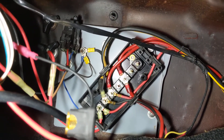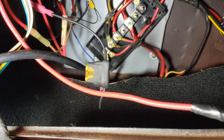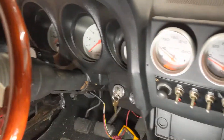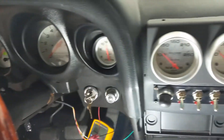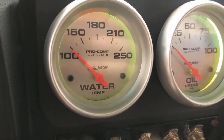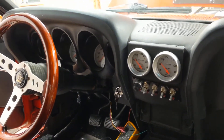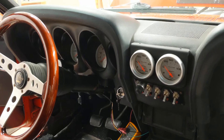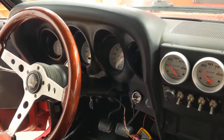Just finished wiring this up. There's a relay up on the top left, and there's an inline fuse for the ignition switch — always good to have a fuse when you run a new power wire. Did a quick ignition test: the gauges come on, the gauge lights are wired up right — all good. I'll button everything up. This is kind of temporary — I'll run it for a year or two until I take apart the dash for the AC, then I'll redo all the wiring, move the gauges, and get rid of the switch panel permanently.